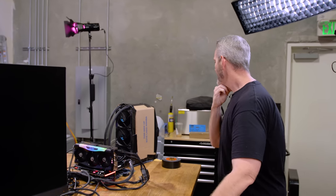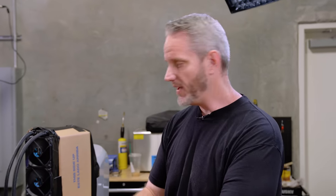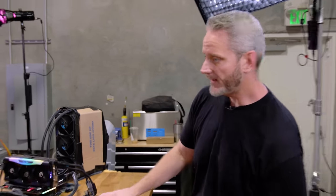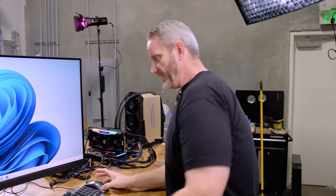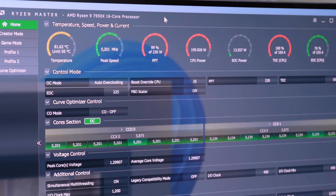It's down to 66 degrees Fahrenheit. We don't live in a cold climate but we can just open a window and get stupid cold temperatures. This is definitely bringing it below ambient temperature now. The way it should work with water cooling: if your cooler is maxed out, every degree you drop the radiator temperature is a degree of cooling for the CPU. The fluid temperature was around 30C and we dropped it — core temps of the CPU come down proportionally. Let's see what the temperature does now: 74, 77, 78, 80, 81. We've controlled it.